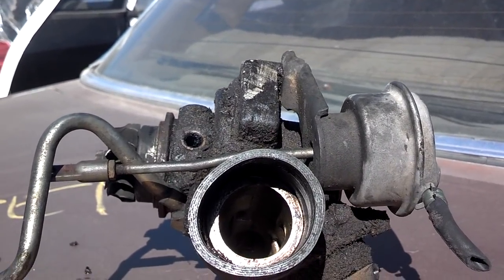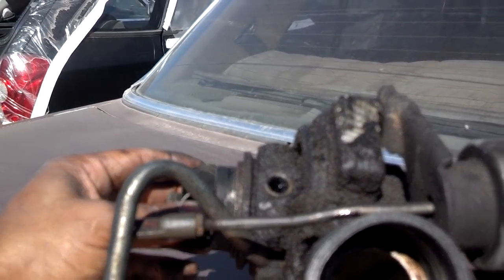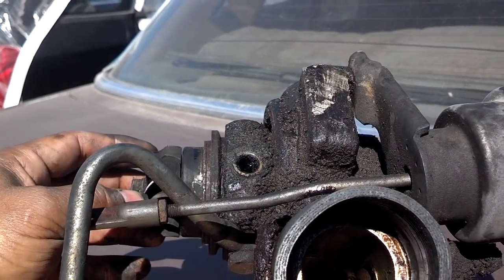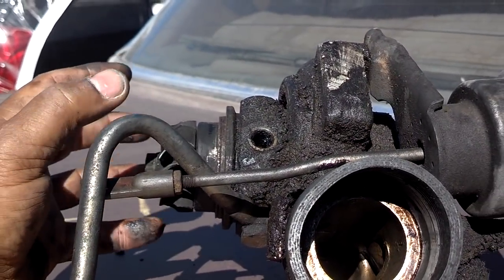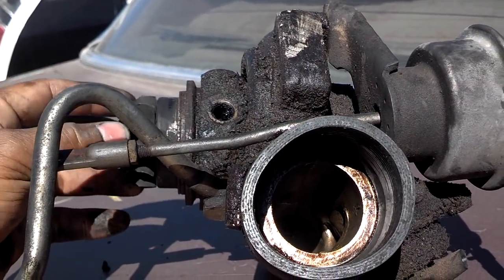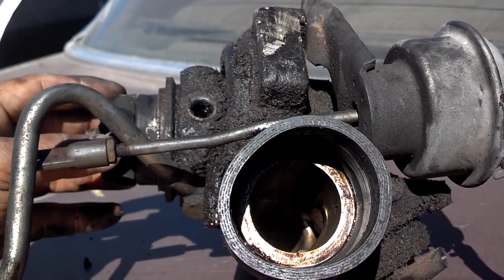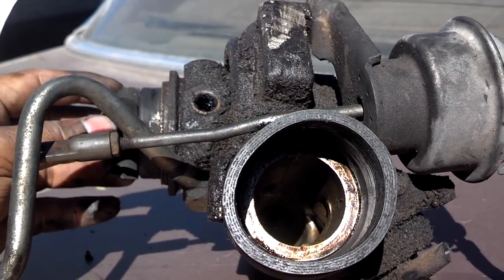So there you have it. The most common thing is for the shaft or bearings to wear out — you'll get shaft play (wiggle or in-and-out) and they smoke when bad. If there's a total failure — extreme blade damage or a seized shaft — you will get no boost pressure at all, which will basically cripple the vehicle. If a car is designed to operate with a turbo and the turbo seizes, it will be starved of intake air, and the car may only drive 10 or 20 miles per hour.